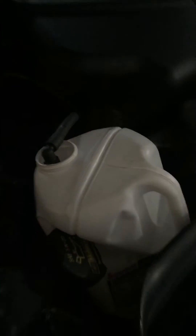I took that line and put it in a milk jug. Then instead of cranking the key and cycling it a bunch of times, I jumped the relay. The fuse for the fuel pump is fuse number 13 — this is a 2014 V6, and it should be similar on the GTs from 2011 to 2014. It's a 20 amp fuse, go ahead and pull that.